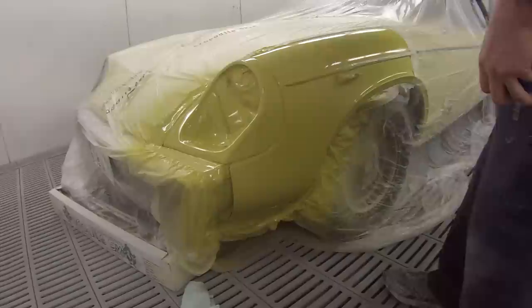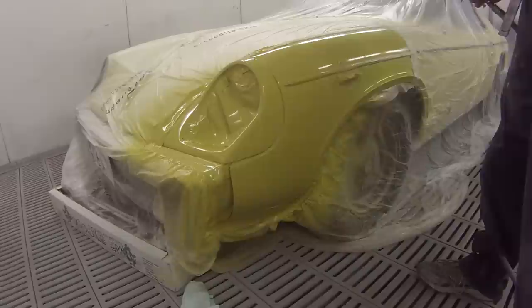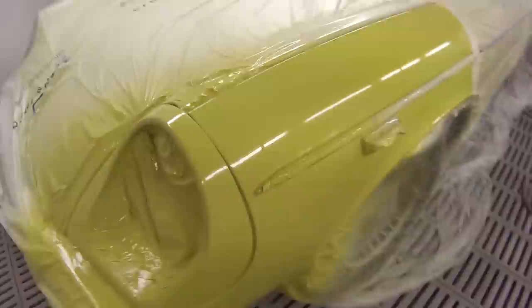The mini gun is good for the blending thinner — just be careful not to go on too wet. The small fan won't overload the paint. If you put blending thinner through your main colour gun, be careful — I did that as an apprentice at trade school and had a big run. As you can see here it's looking quite nice off the gun with just one or two little bits of dust, and the polishing stage will be in the next video.